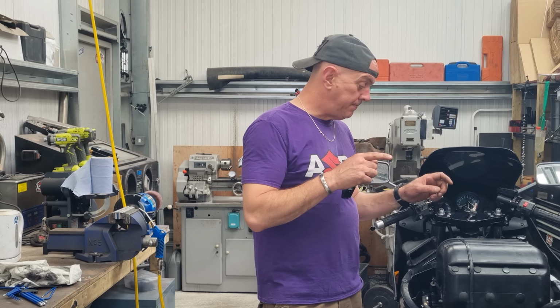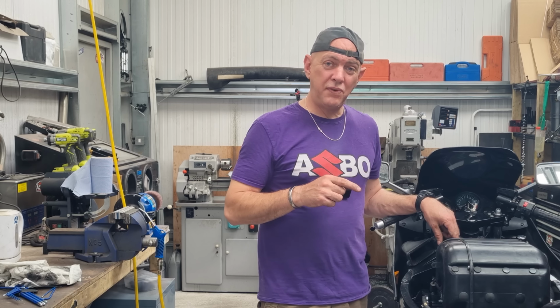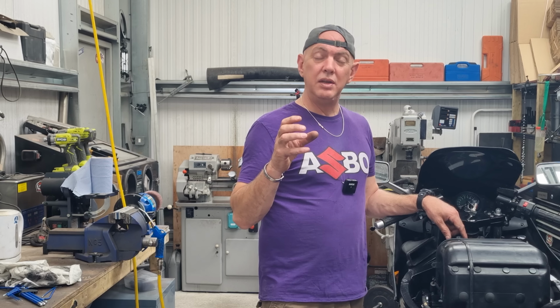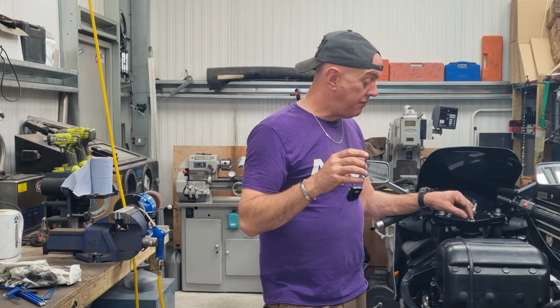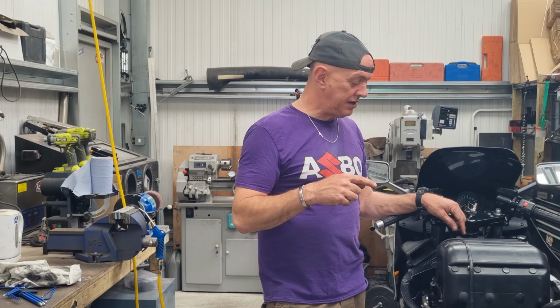So I've had the plug out of cylinder 2, because that is definitely the one that wasn't firing, because you could feel the header pipes and it was cold. All the others were roasty, toasty hot. So we've had the plug out of that and checked it. Shoved it back in, exactly the same again.